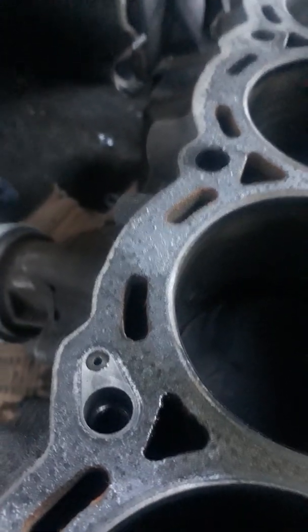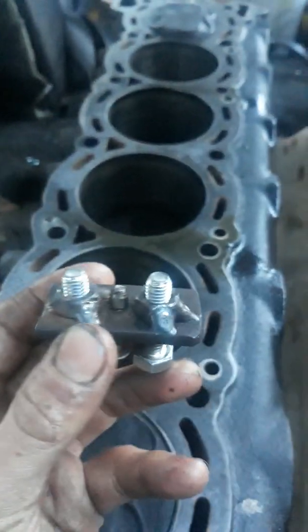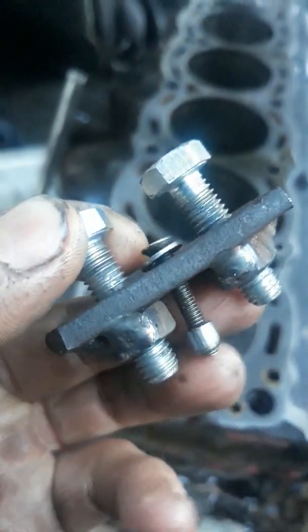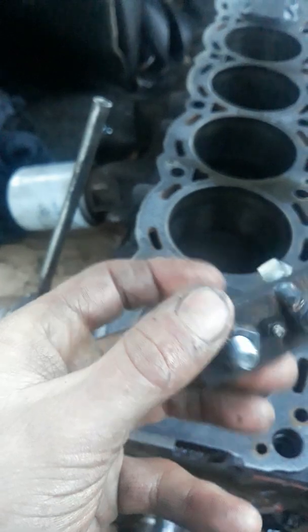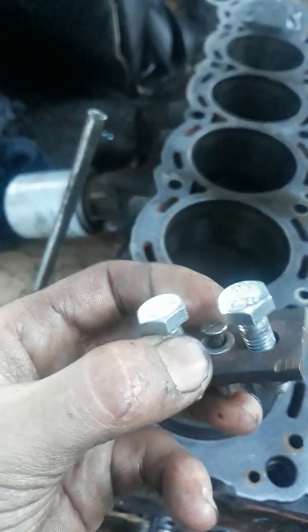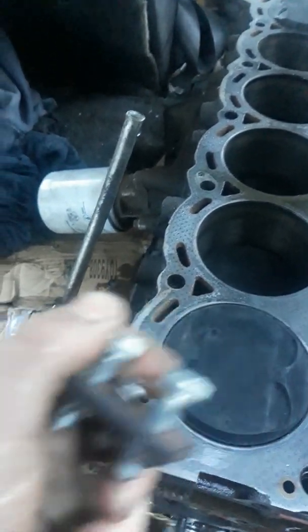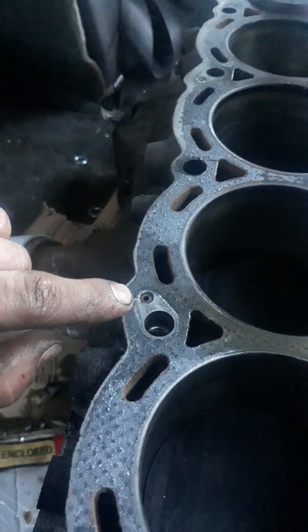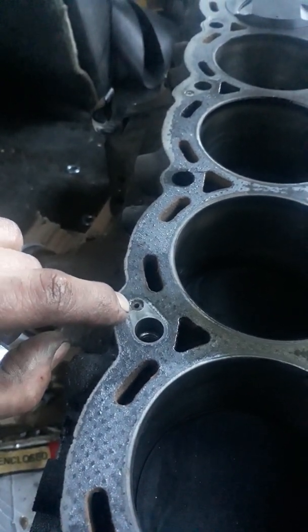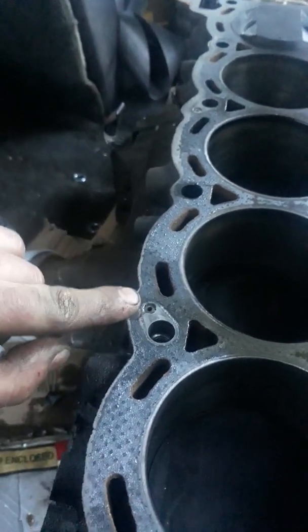So what I made is a little pulling tool to get them out. That's the old restrictor on the bottom. You've got two welded little nuts on a piece of steel — the bolt and that nut there is an M4 by 0.75 I think. So you just get an M4 tap, drill the restrictor out to the size an M4 tap requires — which would probably be about 3mm or so — then tap it to M4.